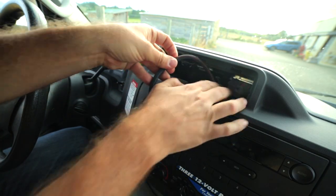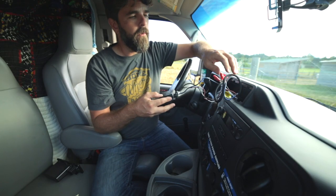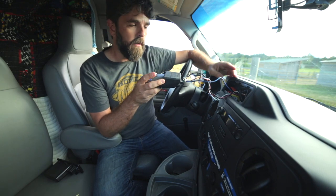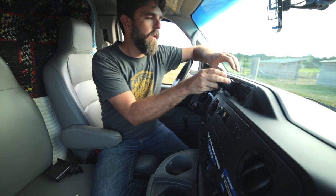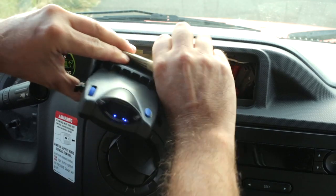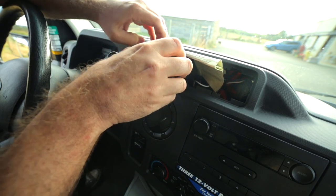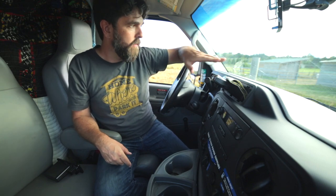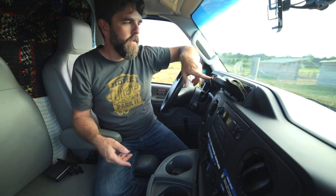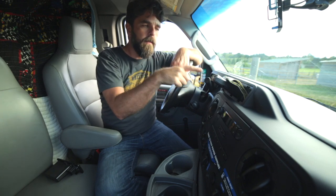You want to connect it like that. In a usual pickup truck, you'd attach the brake controller via a bracket that you screw into the dashboard, but this is a U-Haul truck — you can't screw anything in. So what I do is place it there and take the manual and wedge it in so it stays. You want it pointing in the direction of travel — pointing forward — which is what it's doing here. It can sit on an angle, so make sure you buy one that allows that, so it understands that position as neutral.